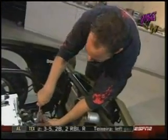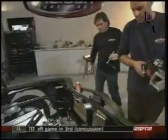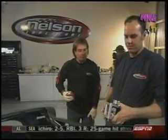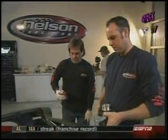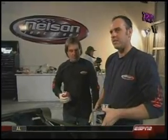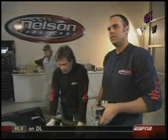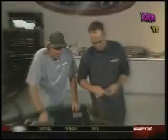There's a lot going on under this hood, so the Camaro will need a beefy alternator. This is a 200 amp alternator, where normally a car like this comes with a 65 amp alternator. We went to the extra capacity because we have 2 fuel pumps and 2 electric fans that are cooling the transmission cooler and oil cooler. David wants a cigarette lighter and a radio, so.